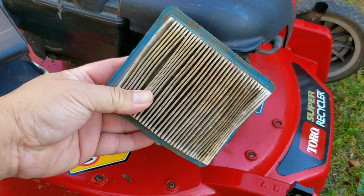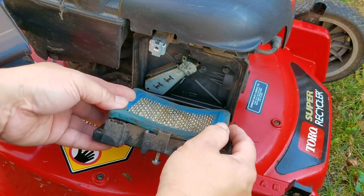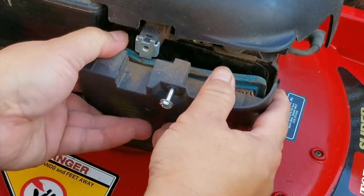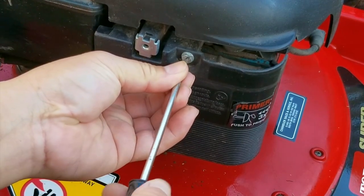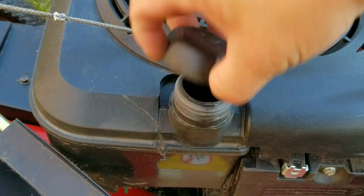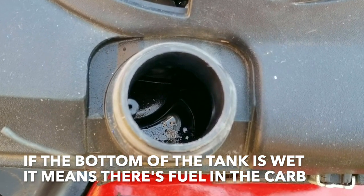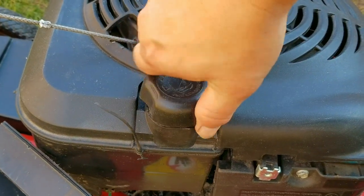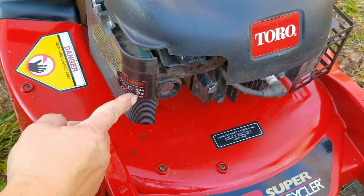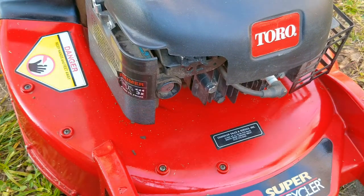What happens most often is a serious miscommunication, and it starts with the manual. Correct me if I'm wrong, but at the factory they have to test the engine just to make sure it will at least start and run. After confirming that, they will drain as much oil as possible, probably through the fill tube since it's easier. Then they'll send it down the line so it can be installed to the mowing deck, boxed up, and shipped out. What sometimes happens is that the consumer will pull out the dipstick, see that there's oil on it, and say, 'Oh, there's already oil in it,' and proceed to add gasoline to the fuel tank. Then about 10 to 20 minutes later, the engine will get slower and slower until it finally stops. At that point the owner will try to start it and realize the pull rope is stuck.